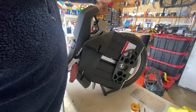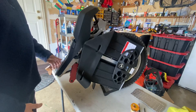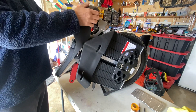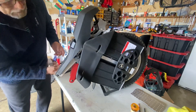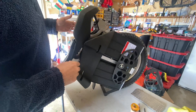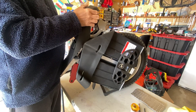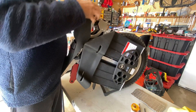To get to the motherboard, which is right here under the front part of the cover seat, the way to get to it is you remove this. Gotway has glued these down, so the glue part is here around here and on the back here. What I would do once you remove it is use velcro so it is easier to take on and off. Just grab the sides and keep rocking it back — don't yank on it because you may rip the seat. On a nice warm day, remove it and pull on the front and just work your way to release the glue.